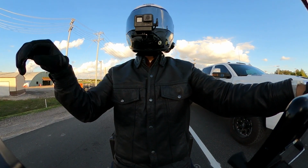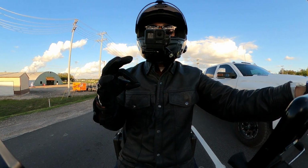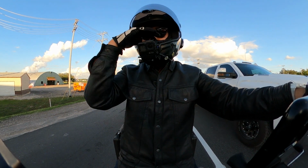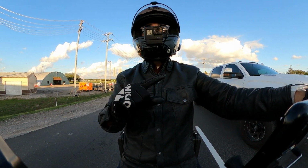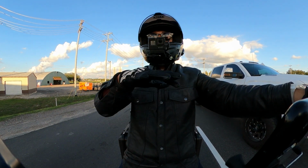Shortly after that, we got the idea to swap from the sport bike tires because we added the bags back on, and something about the weight had me uneasy. For the sport bike tires, we were just under the load rating for the rear, and over the load rating for the front tire. So for both tires we were right on par.